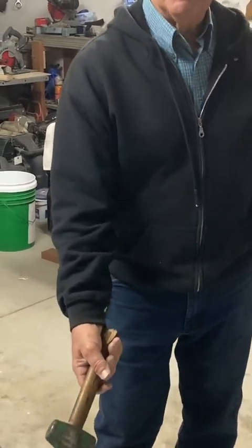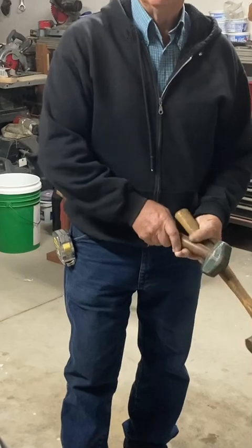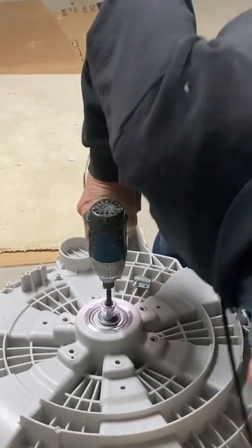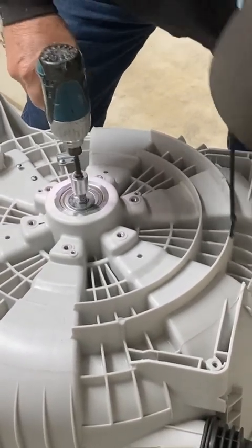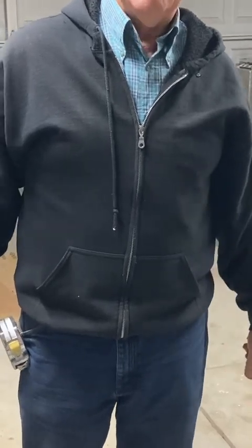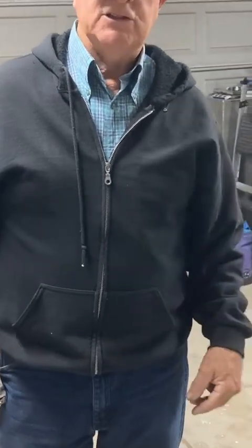The shaft dropped out of there. The bolt and washer being on there kept it from falling all the way to the ground. Now we'll loosen that bolt and remove the whole tub assembly — the shaft is all the way out. That's all it takes to drop that tub out of this housing. Some shafts and bearings are going to be more damaged than others, but most cases this is how it should come out. If you try to remove these things horizontally, they're going to work against you. Let gravity do its job and it will help you remove the tub.